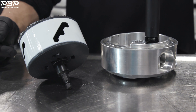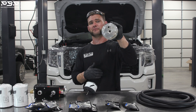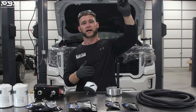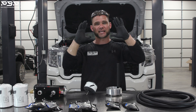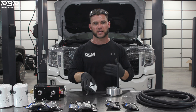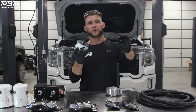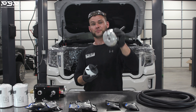Speaking of installation, let's go to the repair shop and put in one of our big Pac-Man fuel sumps. We've got our 22 L5P on the rack, ready to make power and install our big Pac-Man fuel sump. Before we do that, we want to invite you guys to check out our baby Pac-Man sump install video — we go over how to drill the tank and where to drill it. That is step one. This is the big Pac-Man fuel sump and it requires a 3 and 7/8ths hole saw.